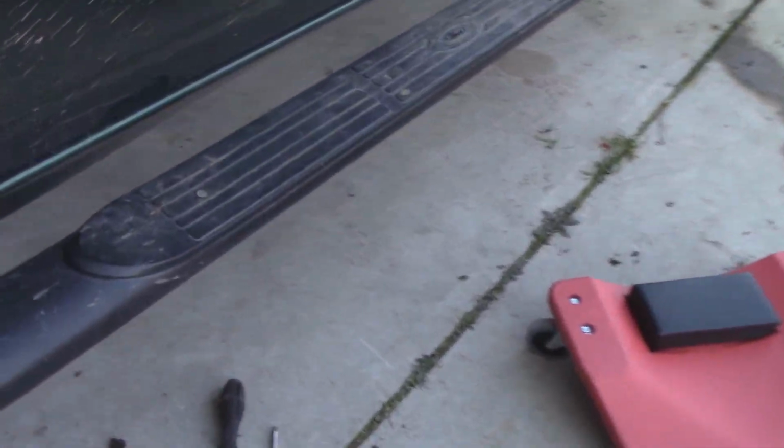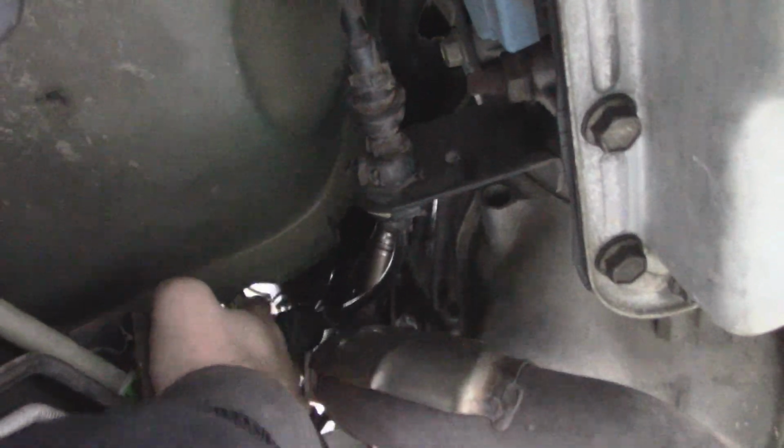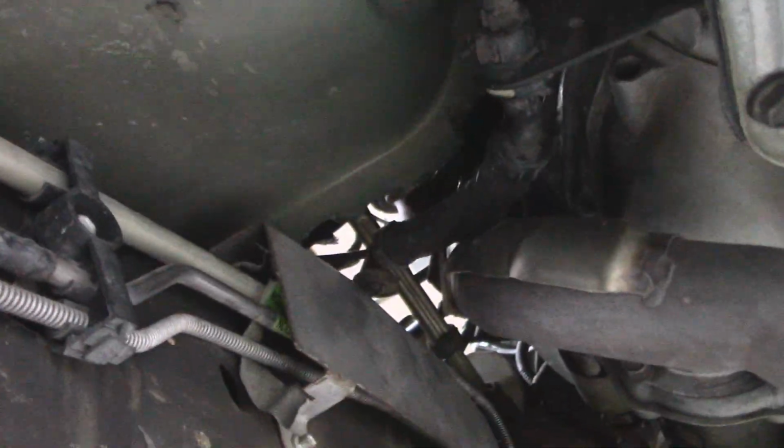There is another thing I want to mention, and that's besides putting all your panels back in, your access panels, you want to make sure that if it's been moved or knocked out of the way, and you have an automatic transmission like mine does, you'll want to slide this heat shield back down for your transmission selector. It goes right in there on the side of the trans, and yeah, just bring that little guy back down because that protects that cable from the heat from the exhaust.